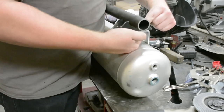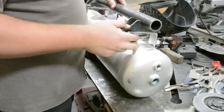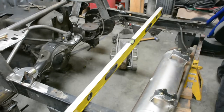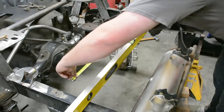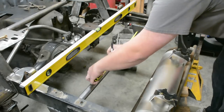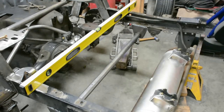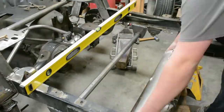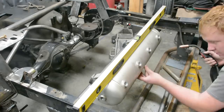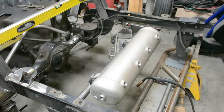I'm fitting up to the 1.5-inch bar, and once everything looks good I'll snug them down and take the tank over to the actual cross member on the frame. I made the frame cross member a bolt-in cross member so it's super easy to take in and out and paint — I already had to use it once and it's a great feature. I mark the center of the cross member on the frame, do the math to figure out where each side needs to go. I want everything to fit underneath the factory bed — there will be a hump in the middle of the floor, but I want everything else to fit under the bed.